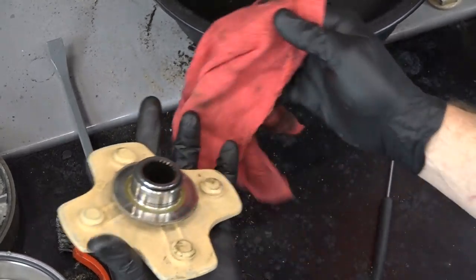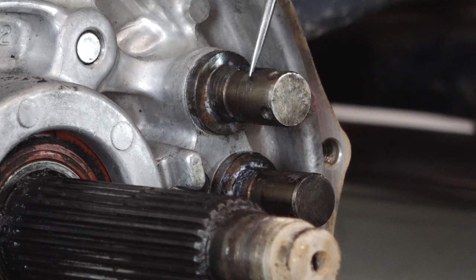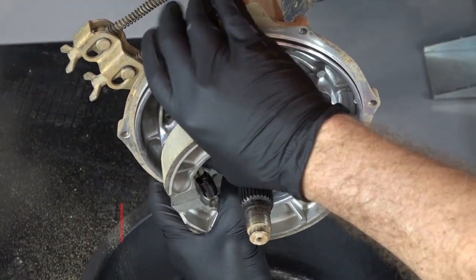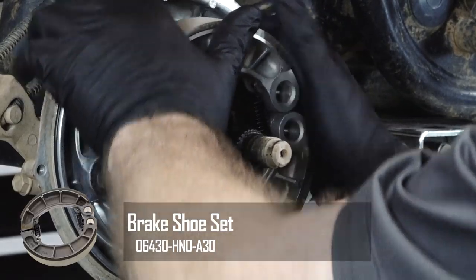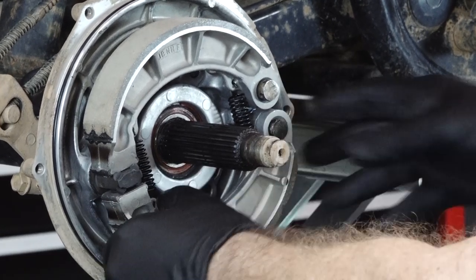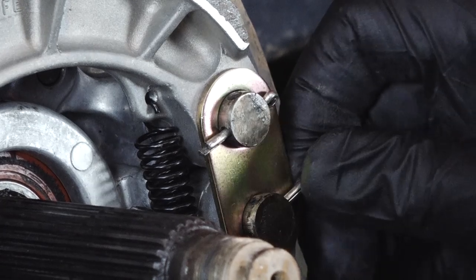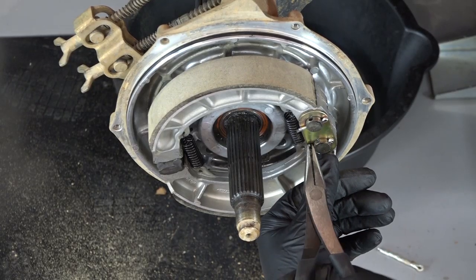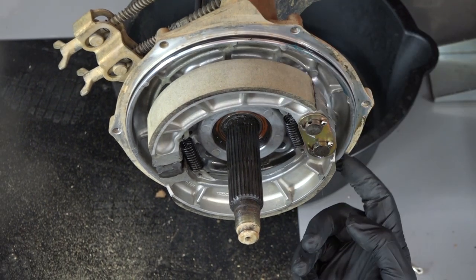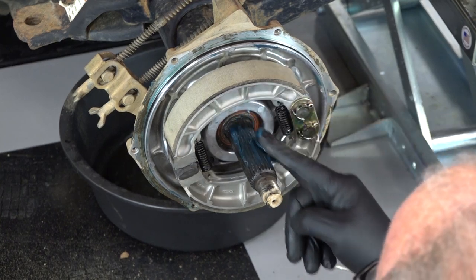Now let's go ahead and start putting it back together. Take a little bit more grease and put it on these two pivot points — there's a channel where you see where it steps down, that's where you want to get most of your grease. Now let's get the brakes wiggled on there. I prefer to do it with the springs already on and you basically just walk them on. A little bit of a tap, there we go. Now we can get that outer plate on and those two cotter pins that hold it where they both pivot. Before we put this on, go back to the grease and put a light coat on this O-ring — just make sure you don't dab any onto your brake shoes. Put a little bit more grease on the splines because we're about to install the brake drum.